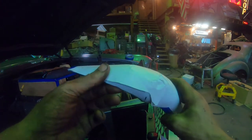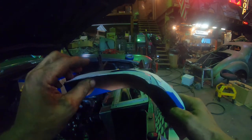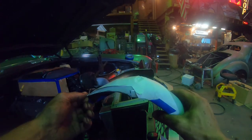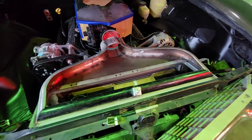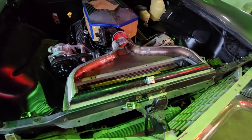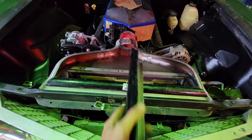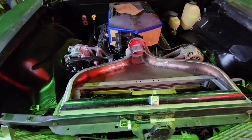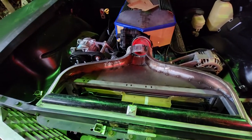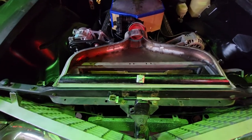I pulled my pattern off and inverted it, because I need a mirror image, not an exact copy — so all that tape's down underneath. There's where I need to notch. My second piece laid in there nice — the notch turned out good, didn't have to fine-tune it with the grinder at all. I got my little pieces butt welded in. I used panel butt weld clamps — those things are a lifesaver. There's no way I was holding two pieces, keeping everything straight, and trying to tack weld all at once.